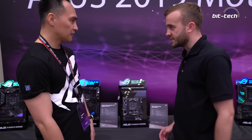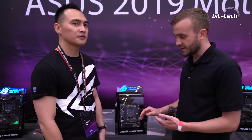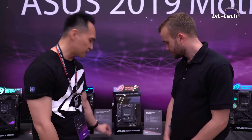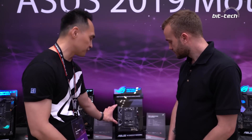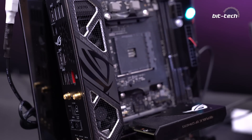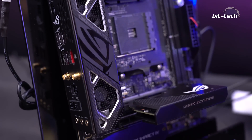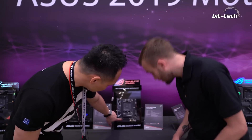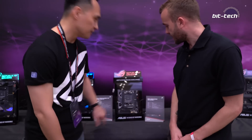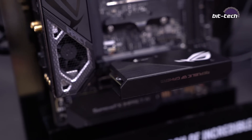To clarify, it's the same width as Mini ITX. If your case can handle a dual-slot graphics card horizontally, it's going to be fine. This Mini DTX form factor gives space for a larger VRM, and it also has two fans to cool down the CPU. The chipset is positioned underneath the board somewhere here, and it's actively cooled by the fans.